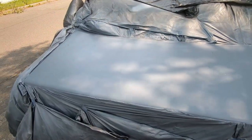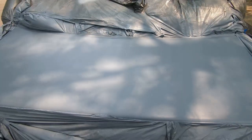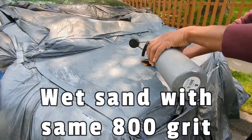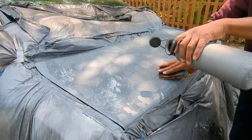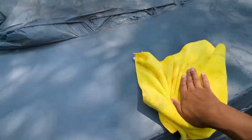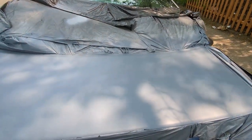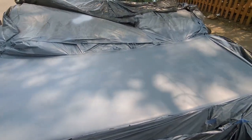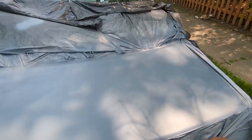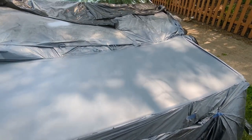Now we're not going to jump straight into the next stage of paint — first we're going to lightly sand the primer down. It won't be as heavy as before; this just creates small scratches so the paint can stick properly to the panel. Then we dry it off — we're not painting over a wet surface. Now it's finally time to spray the paint, following the same technique as with the primer: up close, quick overlapping strokes. We're aiming for two medium to thick coats.